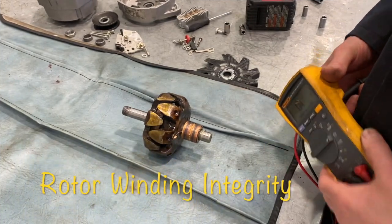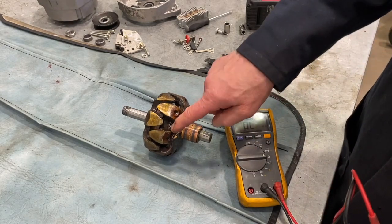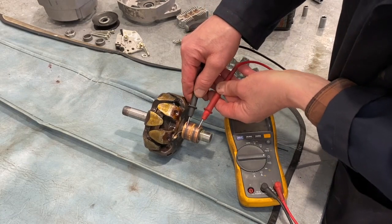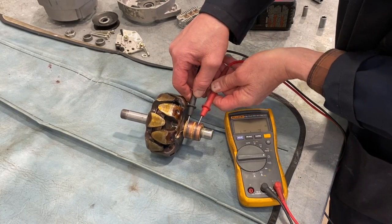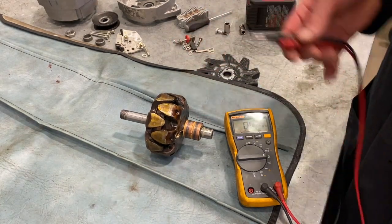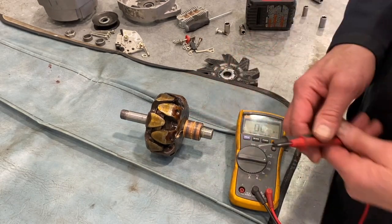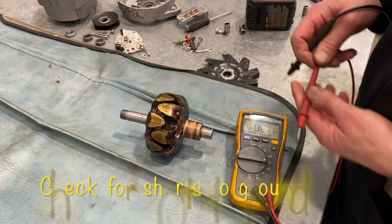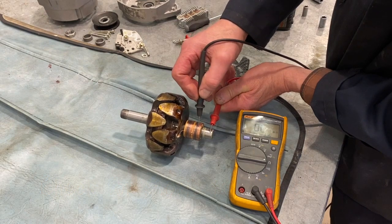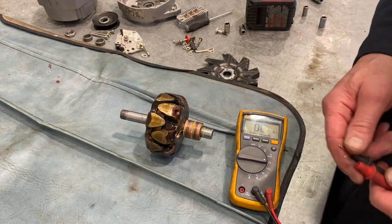Here are some straightforward tests you can do with an alternator. Take your ohm meter out, set it on the ohm setting. What you want to do is check the winding continuity through the rotor itself — just go from slip ring to slip ring and read the resistance value. In this case we've got 3.0 ohms, which tells me the winding is continuous from one side of the slip ring to the other. We also want to check if there's any ground to the central part of the rotor — there shouldn't be. It should read out of limit when you touch those two slip rings, and it does. So we have no shorts to ground in this rotor.